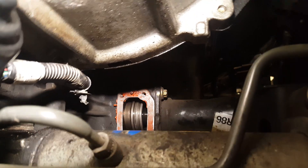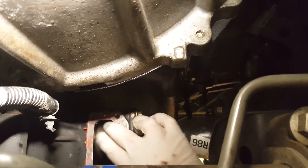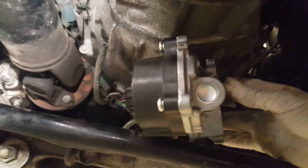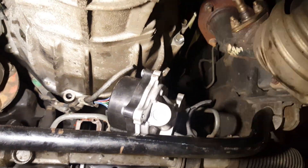Up at the front here, if you look inside you can see a collar in there. If you flip this back and forth, that's how you get four-wheel drive. In two-wheel drive, I'm spinning the tire and it's not spinning any other tire or the driveline. If I flip this little collar, it locks right there — now when I turn the tire, we turn the driveline, so four-wheel drive is engaged. The actuator is basically just this little fork with a motor and electrical connection. These vacuum lines do nothing but vent the unit. On earlier model Toyotas — pre-2004 — they had a vacuum system with vacuum valves, but this does not have that.